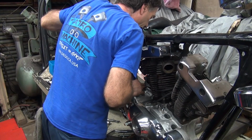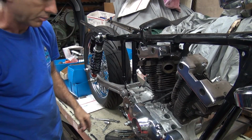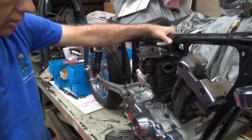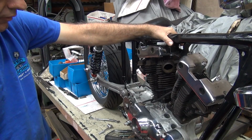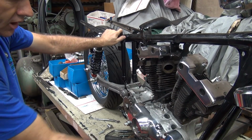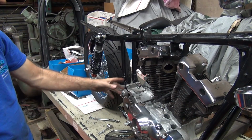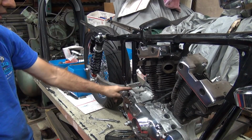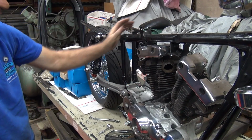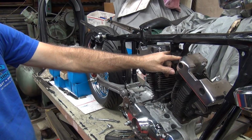Okay, you've got to check that our center pivot bolt looks good. So that looks good over there. This here should be tight, but I'm not going to tighten any more, but it's good. Now see, you've got movement in the motor here? Yeah, that's flex, that's good for the front motor mount. Before you tighten this down, you put pressure on up here, and then you tighten it. If you don't, then all this weight's hanging off this mount, and this mount will break. So the secret is to lift it up a little bit, get some weight off of it, and then tighten everything down unstressed.